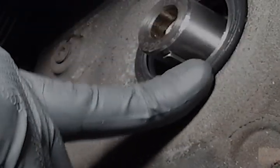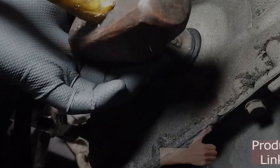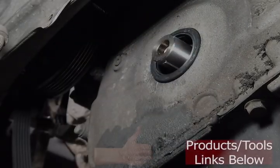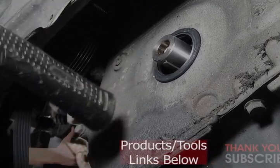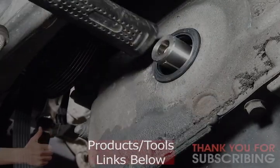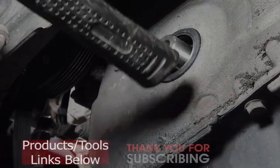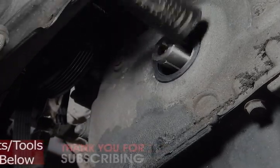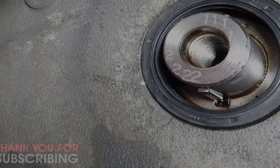Okay, the idea is just to kind of sit it in place. Don't force anything. And make sure you got it nice and flush. As long as she's nice and flush, it looks good to me. Making sure it's nice and flush. Just ever so lightly. I mean, it doesn't take almost any pressure. It's just rubber, so don't want anything really aggressive. I was just using a 36 millimeter. This is with it nice and flush all the way around. Now we're ready to reinstall the harmonic balancer.